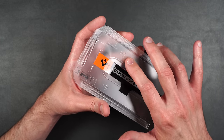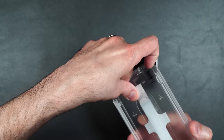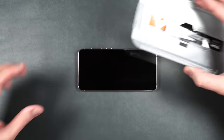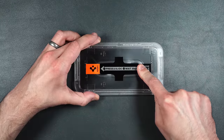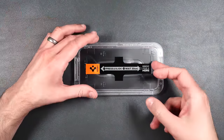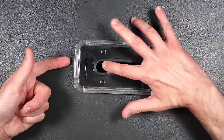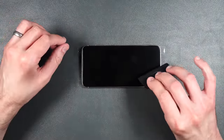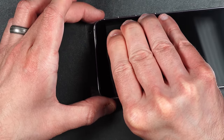Spigen also makes it really easy to install. Take one screen protector, make sure the top signifier is pointing upward toward your camera on your phone. Peel off the little sticker that says 'back' — make sure you don't peel off the glass with it. Don't touch the underside. Line it up with your phone and press it into place. Slide your finger down the middle, then wait 30 seconds, remove the sticker from the top while pressing down on the screen protector guide. Stick your finger in the middle and pull up on the guide. Use the squeegee to get out any bubbles before removing the top protector.